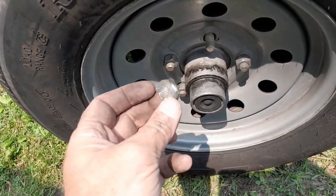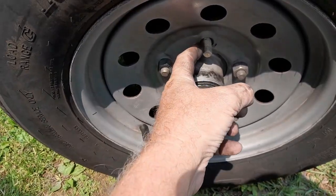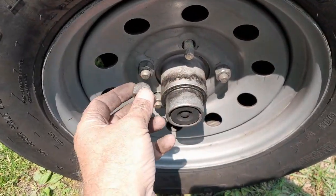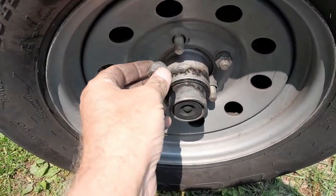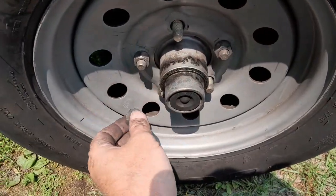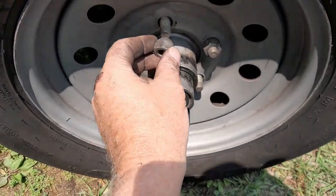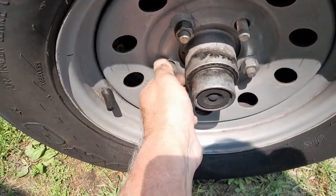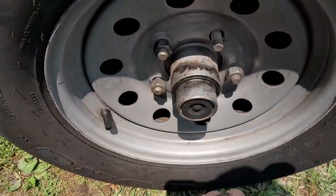Before the closeout — here's one of the reasons you do that tightening pattern. See how the lug nut has a beveled, cone-shaped edge at the end? That's going to go inside the hole while the rest of the nut lays outside. You don't want to tighten one down while the tire is moving, because the tire is going to sag a little — gravity is going to pull it. That's why you want to snug them up and work opposite sides, so the wheel sits properly on the hub.